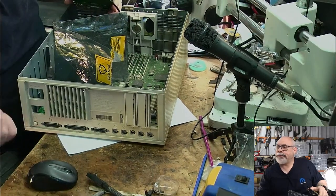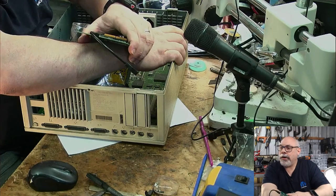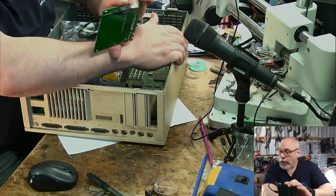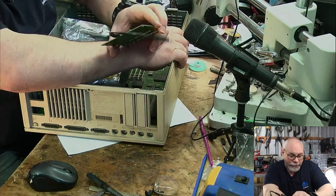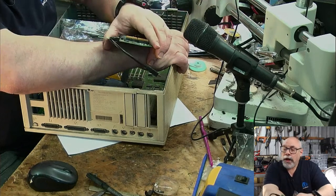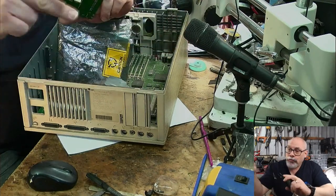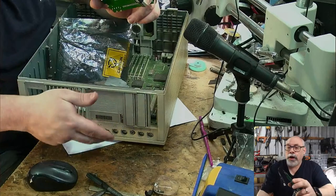Andrew Henderson, hello. Okay. Bought a 2Ci today, but it seems like it has the same problem as my 2Si. No sound and no video. Yeah, now, very important thing to remember about the video. The video out of these things is different to the video out of later Macs. So you need the right sort of DB15 adapter in order to get the video signal out of them. So that catches people out a fair bit. If you buy one of those little adapters that only has 8 switches on it, they can't be configured to get the signal out from these guys. It's something to do with sync on green or not syncing on green or something like that. And so you need one of the adapters that either has 2 rows of switches or the one that I think has 10 switches rather than just 8. That one will actually allow you to configure these for the right signal to come out of the 2Ci.